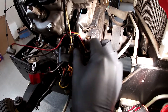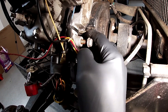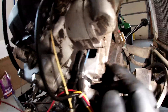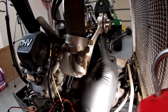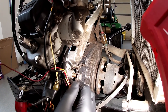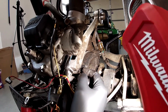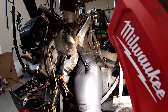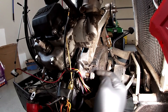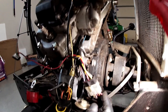We've got a zip tie right above this boss — one black zip tie holding the thing on. I think I'm going to take this fan bracket off because that will reveal the harness and make it a lot easier. The harness is actually zip tied to the bracket. The bracket looks like it's held on by four bolts — a couple M10s and an M8. And then these sensors look like they're just screwed on. Hard to see with all the dirt, but I should be able to back those screws out, loosen those, and then the harness should come right out.